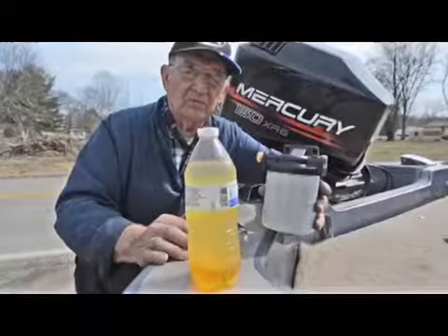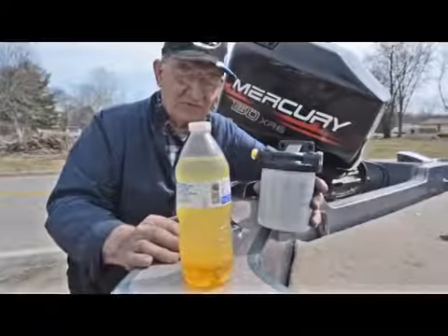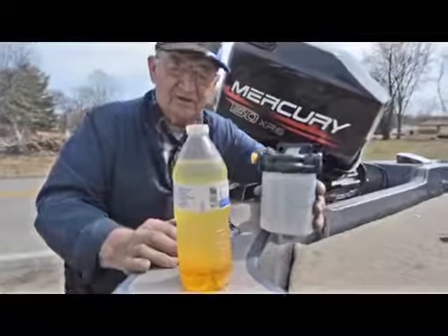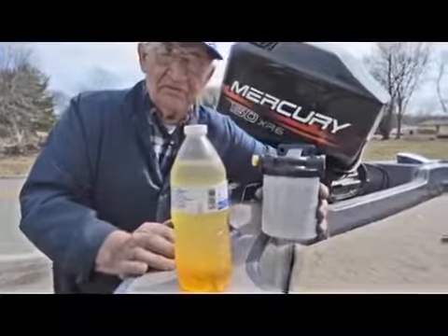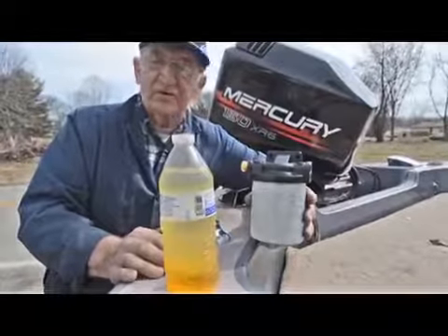It's old fuel. Don't store fuel — shelf life on fuel is about 30 days anymore, and with ethanol in it, it will absorb moisture and cause you problems. That's the reason why you definitely need a fuel water separator before it goes into your engine, because this will ruin an engine.